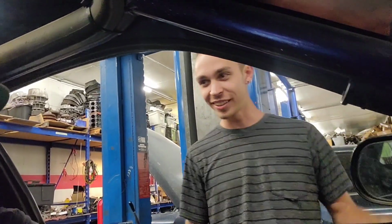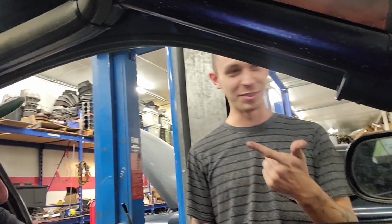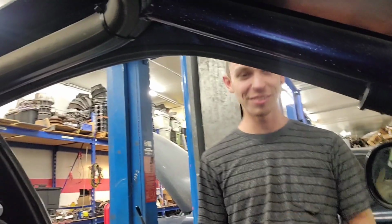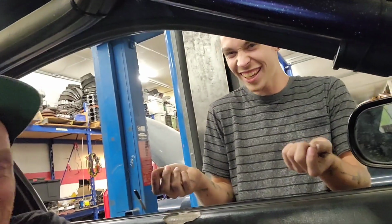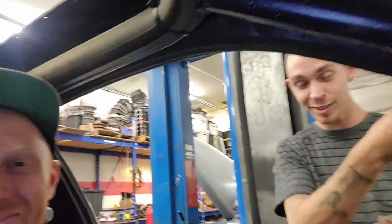And this motor is completely different. There's no knock sensors. There's no oil pressure sensor. This one says NOS. Like 10 connectors that don't go anywhere. There's an H2O sensor in here. There's actually two. There's an engine coolant temperature sensor, and then I had an extra one at the outlet of the radiator, so we could measure the difference between the engine and what was going on in the back.